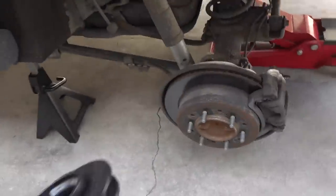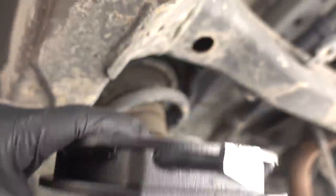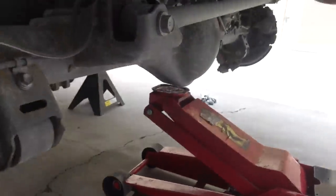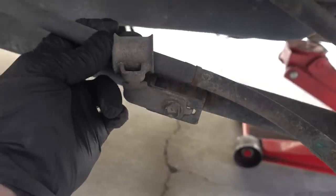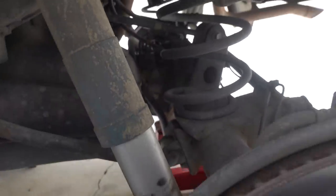I can give you a quick rundown of what's going on this side. This is the spacer for this side and where this goes is on top of this spring here. This perch will go up in there — there's a bolt provided that goes in there. Basically all I have to do is keep the rear diff supported for the time being, then remove this bottom bolt. Also this here for the e-brake, because we don't want this to swing down under a whole lot of tension while we loosen this up. So fairly straightforward, should be pretty simple — a little more simple than the front. I have a lot more space now and some better lighting, so I'm going to go ahead and rifle through and knock this out.